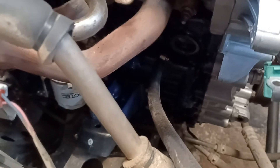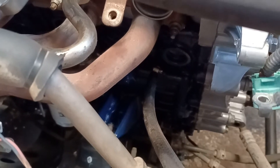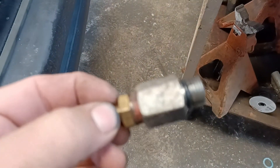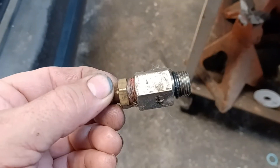This particular motor accepts a 1/8-inch pipe thread fitting. I also have another fitting I made — you can buy these pre-made — but this one does Chevy LS motors, which actually have a plug on the side of the block made to pressurize the system. Hopefully this helps you.